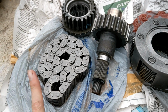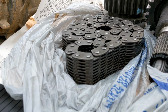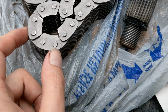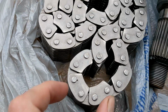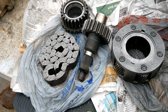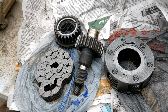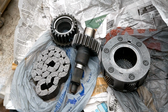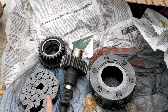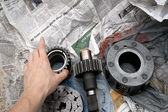The only thing with this, okay, so this is a wide chain kit. It's 1¼ inches, so it's a little thicker. And this looks like a new chain. This is really nice. Wrapped up really beautiful. Looks all oiled, ready to go. So I'm really excited about that. But this kit right here, because it's wider, we will have to leave out our bronze synchro-ring so everything will fit properly. And if you want to keep your ring, you have to talk to him so he can include some other adapter part so that it'll work, but that's extra.